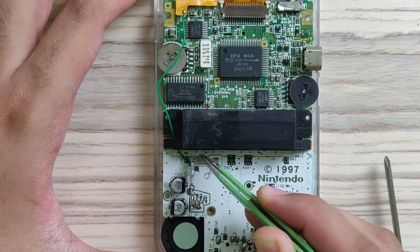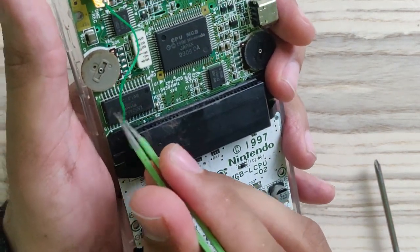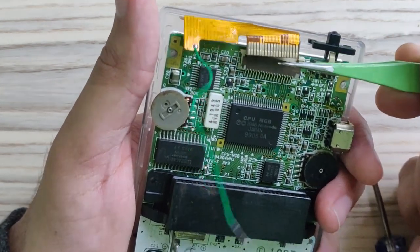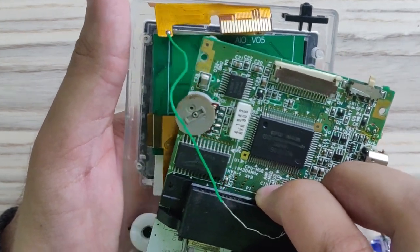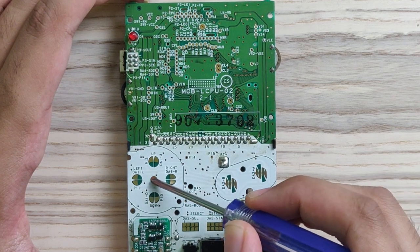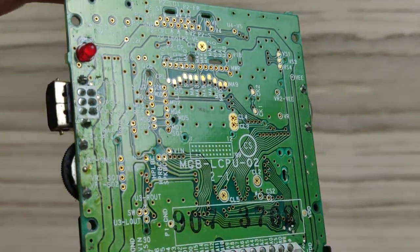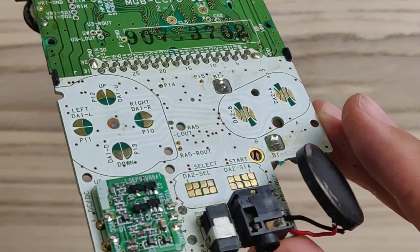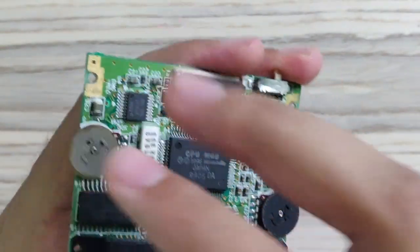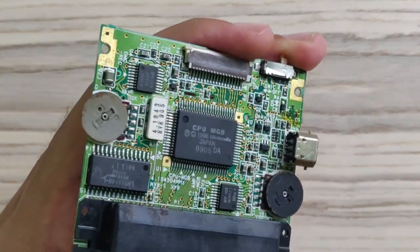There's a cable routed to the battery terminal to supply voltage to the FPC display connector. We can pry it off because it's wrapped around the battery terminal, and it's quite easy to get the FPC ribbon cable out of its connector — now the motherboard is free. We can notice right away that this is a fairly used Game Boy Pocket because of the pivot ball location being indented on the PCB. But the PCB is in very good condition — very clean, and they cleaned it well. The headphone jack is kind of rusty and the potentiometers for brightness and volume are kind of dirty. I don't think you can clean those potentiometers easily with isopropyl, but the connector is definitely cleanable.